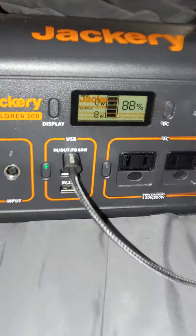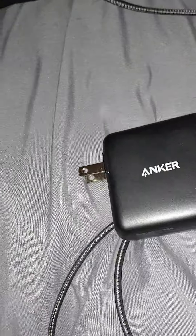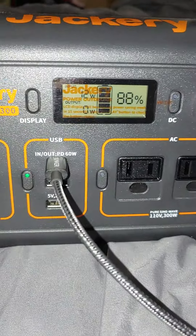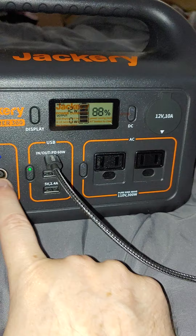So you can see — 10 watts — everything works perfectly, it's at zero. You're going to plug the USB-C in here and it's going to go down to my pluggy plug, and we're going to see how many watts it gets plugged in. So I'm plugged into the Anker and you can see that Anker works because it splits in half — it's a 32 watt Anker brick. If you're using one port you only get up to 15 or 16 watts max. You can see my Jackery is going up. So that's the reason why I bought the Anker — it'll charge much faster and I have an extra port so I can plug this in the outlet and also plug my phone into the Anker outlet.